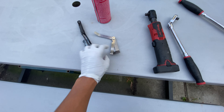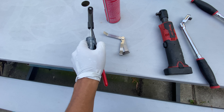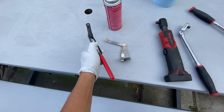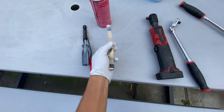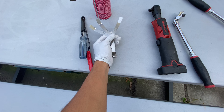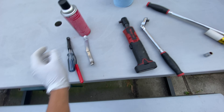These two are the main tools that you need. This one is going to help you loosen and adjust the set screw on the valves. And this is what you're gonna use — this is a feeler gauge, an angle feeler gauge. You're gonna use this to check your adjustments and make sure they're in spec.